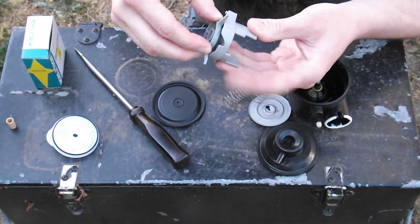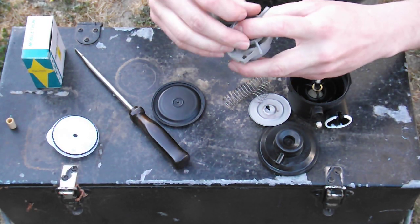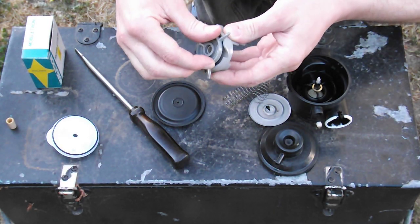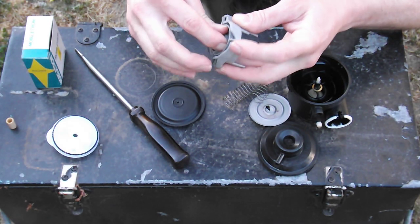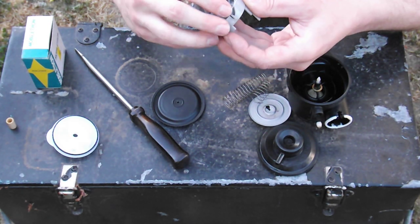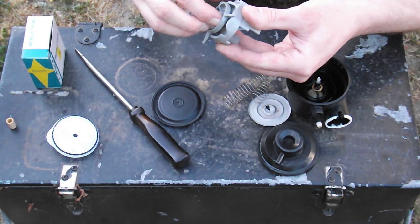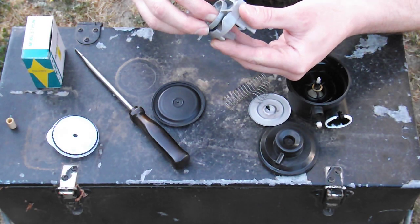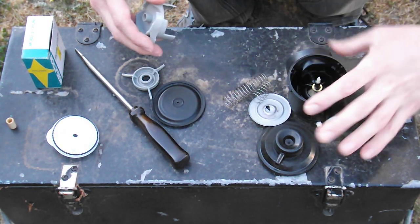In the slow position, that would be slow. When you open the throttle, this plate which is pushing the diaphragm and the pop-it valve up in the closed position drops into - this is the fast, or full throttle if you like. So that's full throttle. And then when this rotates with the cable being withdrawn, it then goes to slow speed and the shutdown position. So we're going to assemble this carby.